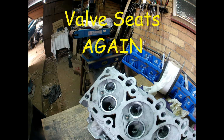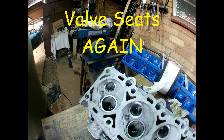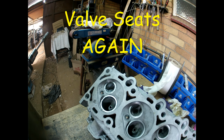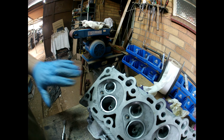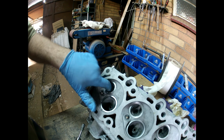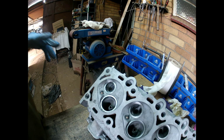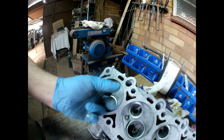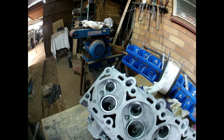Again, as you guys can see, the ports are raw ports, brand new ports with, if my memory serves me right, a 0.15 interference, which is where these heads fell short when they were assembled at the factory. The interference or the fitting or whatever it was wasn't right, hence the moment they overheat once, there's a tendency of dropping valve seats. So this is supposed to rectify that, these guys claim, and they come highly recommended. They say they've done many such heads and never had a comeback. So let's see and let's hope. Well, we don't need hope when we're doing things properly, eh?